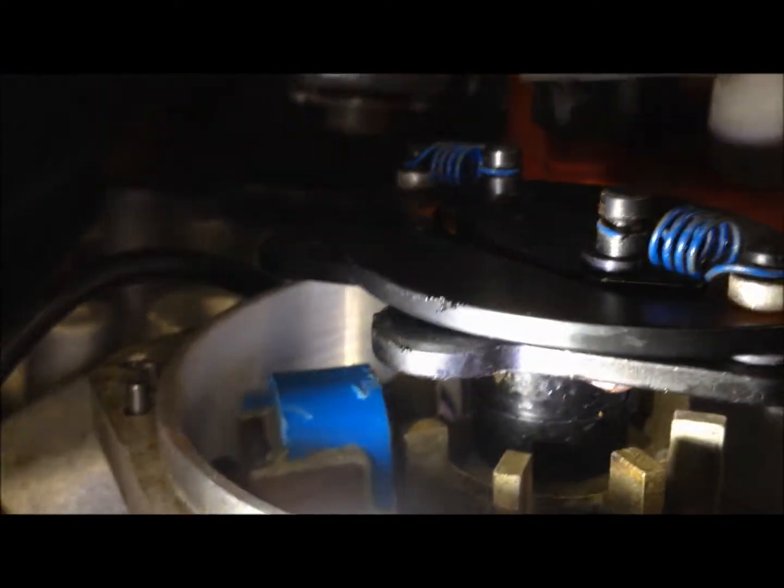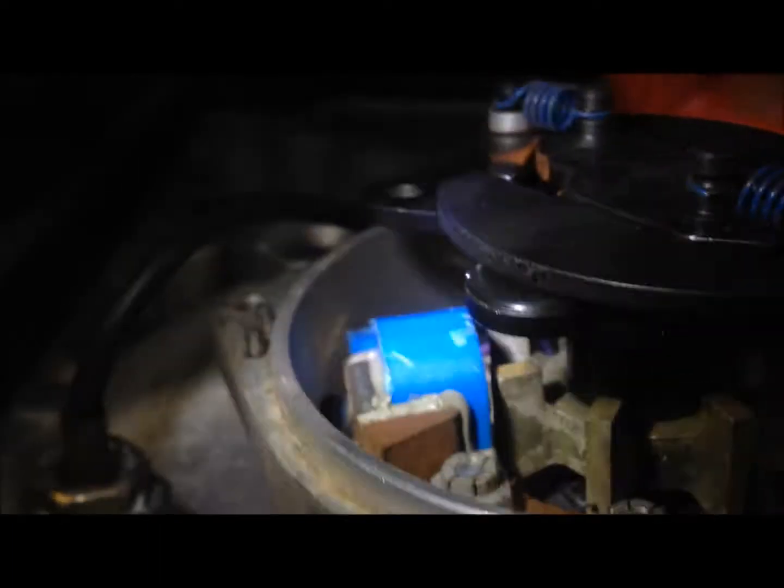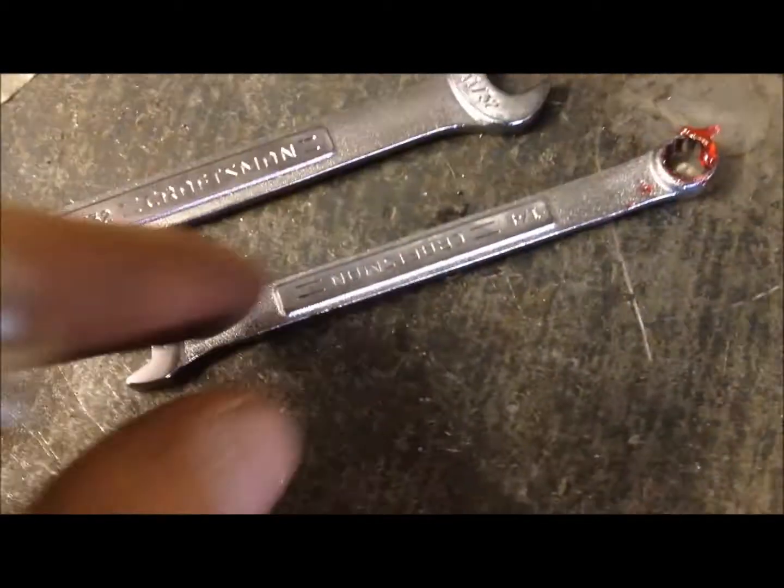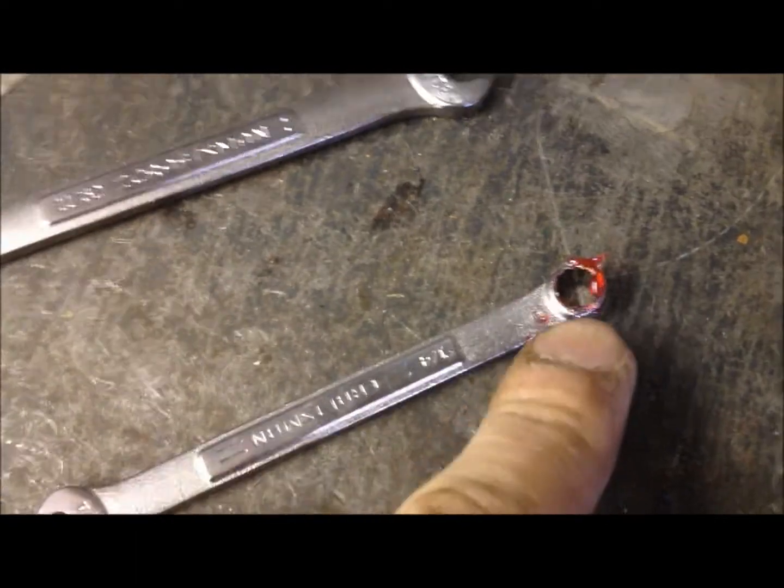There's a light here, but what I like to do is turn the engine so that little nut is facing me and it's away from the magnetic pickup, so you have a lot of room. What I like to do first is use a smaller wrench — something like this quarter here — where I set the bushing on top of it and I use some grease so the bushing sticks right on like it's supposed to.